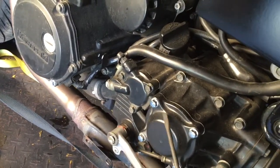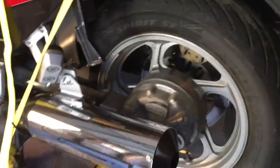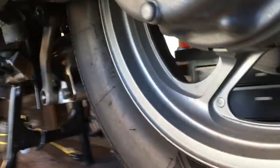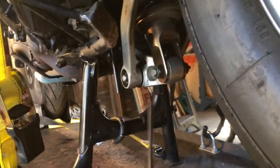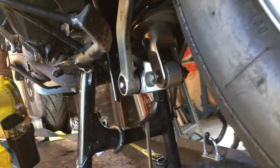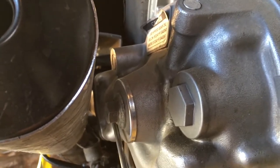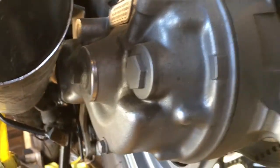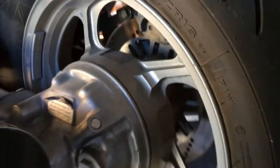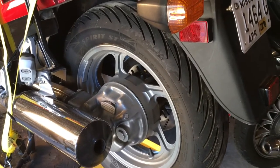Unfortunately, the drivetrain has to come off, and a few other bits around here, to get this case out. So it's a big job, and we start by taking the wheel off. I have it on the center stand, and somebody on the forum said if I take this bolt out right here, the rear end will drop enough so that I don't have to take the muffler off in order to get the axle out. So I'm going to try that and see if it works, because you have to drop that wheel to get it past this fender, and I don't want to cut fenders.